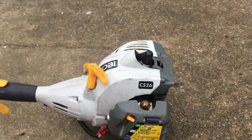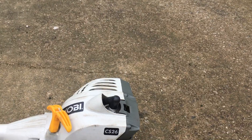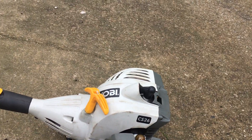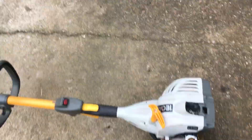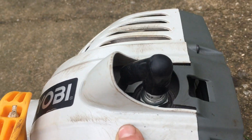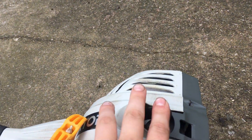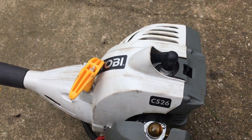It's not the coil — I'm telling you what this is. Get an air compressor, take out the spark plug, get your long nozzle — let me show you — get one of these and press the air around in the cylinder. Make sure the piston is all the way down by looking in there. You can see it's all the way down. Blow all the way around, blow the spark plug hole out, and then put the spark plug back in and it will start and run.